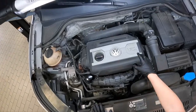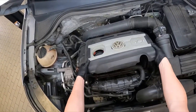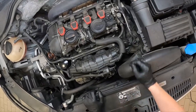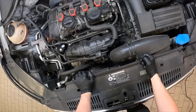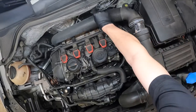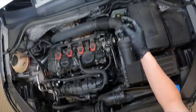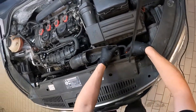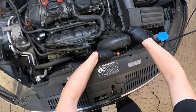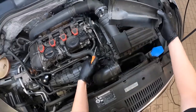Looking at the top of the engine, the vacuum pump is going to be located right here underneath the engine cover. So just go ahead and pop this up and set it aside — and there it is right there. The next step is going to be to remove the air box. Disconnect this connector right here, then remove this plastic panel — there are three little tabs — and set it aside. Take your pocket screwdriver, hit this tab on the side, and this one as well, then tilt it out and set it aside.